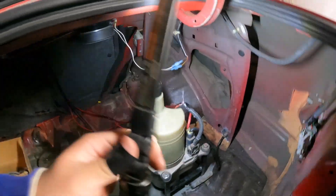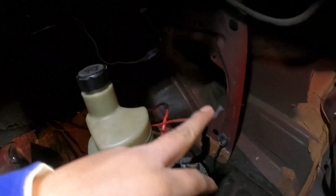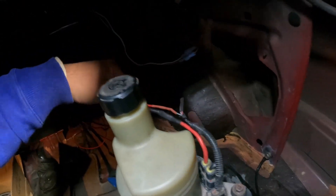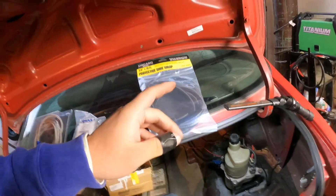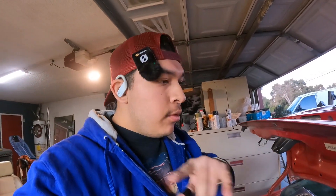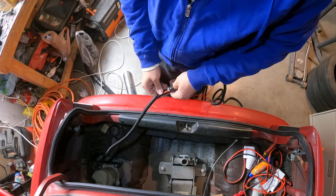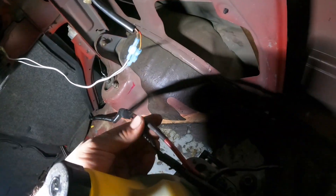The plan is - I'm gonna cover these two extra wires. I think they were for something but I'm not sure what. I'm just gonna loop them together and loom them up, put them under the carpet. It's gonna have to split off because one's going to the battery and one's going to a 12-volt ignition switch.